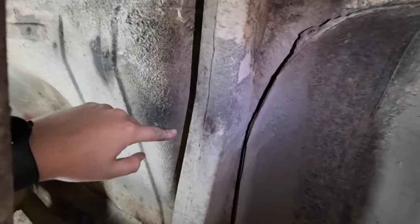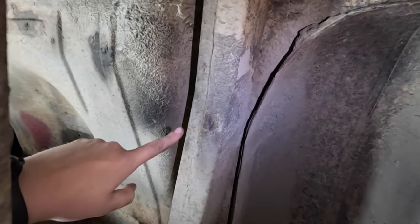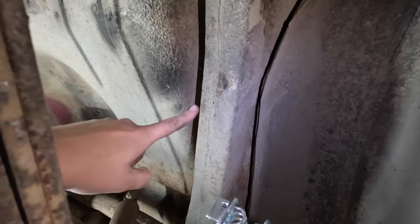So I'm going to match these side to side as close as I can, kind of figure that out. So I'm going to grab me a center punch here and get that drilled, and then we'll go ahead and get that tapped, and see if we can mount the rubber lines here so that I have a target to get to from over there at the T, and so I know exactly where I need to finish up at.